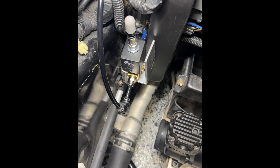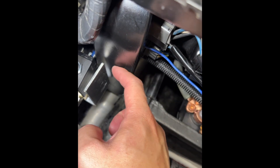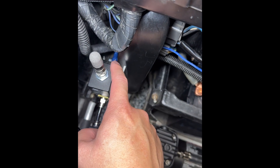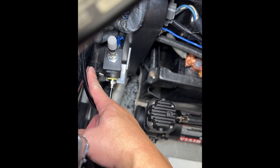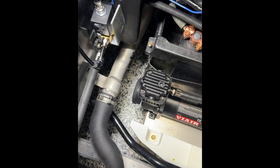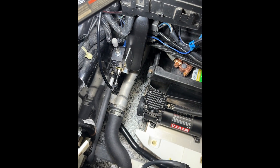I'm going to go ahead and get it printed up in stronger heat-resistant plastic and then we'll be good to go. Here's a look at what my DIY bracket used to look like - it was made out of a single piece of aluminum. The clearance of this tube was very tight, the connectors were really close, and it was sitting about an inch away from the frame rail, which wasn't ideal. So it's a really big improvement getting it farther over and pulling it forward to give more clearance and more room to make connections.